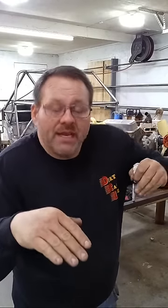But basically what I'm trying to explain is, you think about it from this standpoint right here. Are you sitting your car down on the right front? And how much are you lifting up your left rear? In other words, is your car compressing, or is your car rolling over? And what are you wanting to do?